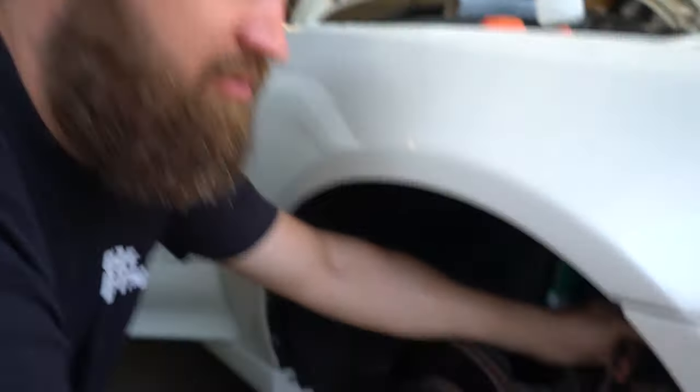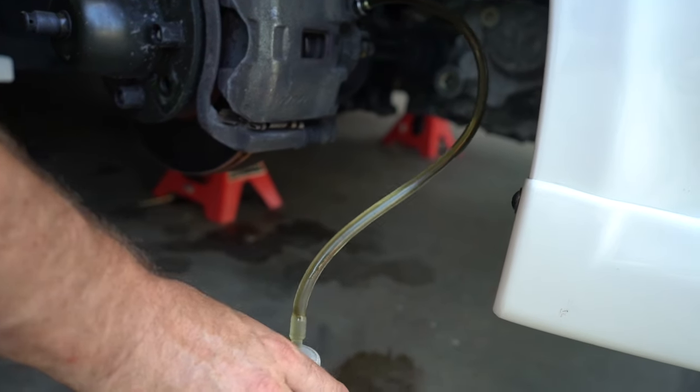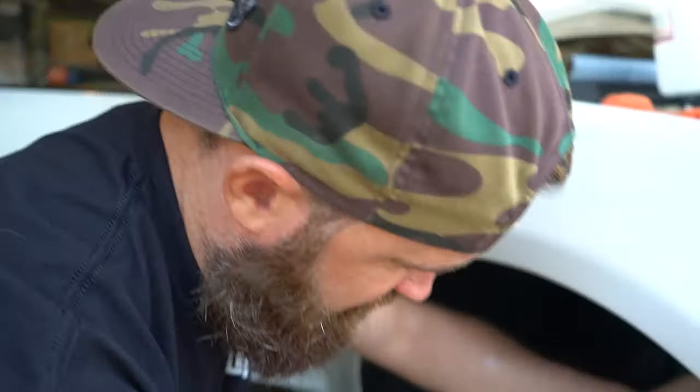Open the valve — we've got actually no flow. So it's basically good to go. The car is all buttoned up and the wheels are back on. It's time to go for a test drive and make sure we did a good job on these brakes. As long as the brakes are feeling stiff and firm and the car is stopping well, we know we've done a nice job. If not, we just repeat the process.